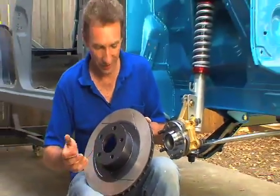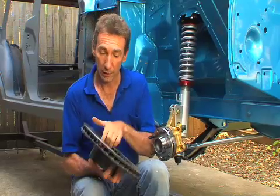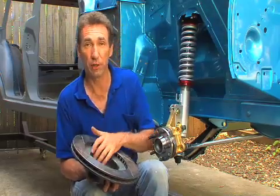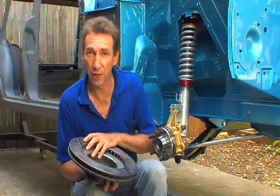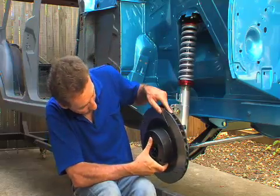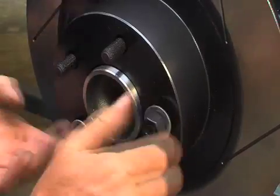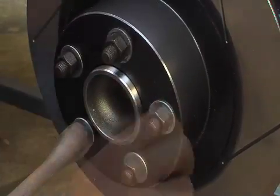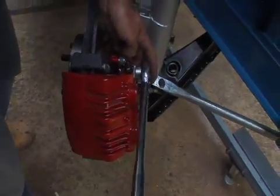Moly carbide rotors — just look at these. They're good looking and lightweight too. This is a Phase 3 330mm slotted rotor and it's about 1.2 kilos lighter than any other 330mm disc. Slip the disc on and tighten it into position with the five nuts and washers supplied with the disc kit. Tighten them evenly, not too much though, working opposites as you go. Then remove the nuts and washers, slide the caliper on and install the two bolts to the recommended torque settings.